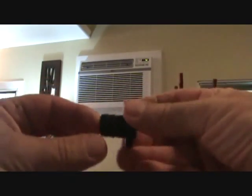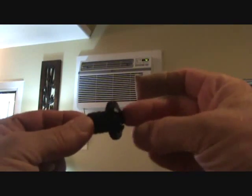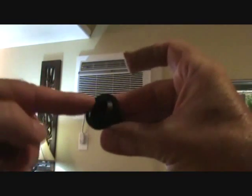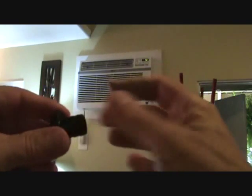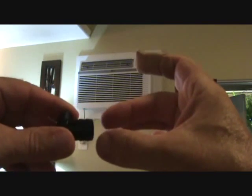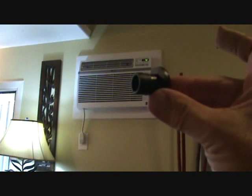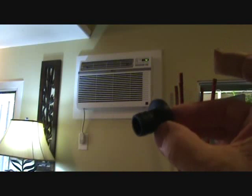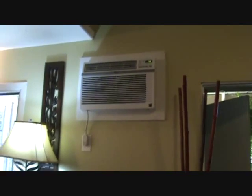It also came with this — it's for the condensate drain line on the back side. It's always a good idea to use it. There's a little washer and it snaps right into the opening. There's a little rubber grommet on the back side of the conditioner and you snap it in. Then get a flexible tube — for this one it happened to be five-eighths inch, but they're not all five-eighths, so measure yours. I'm glad I did that so I know what size hose to get at the store.